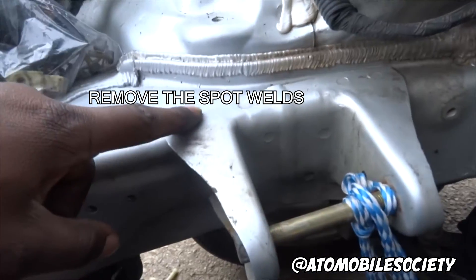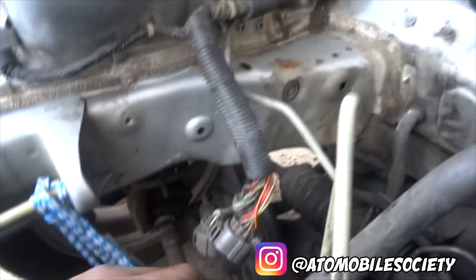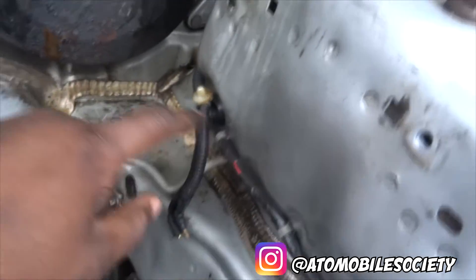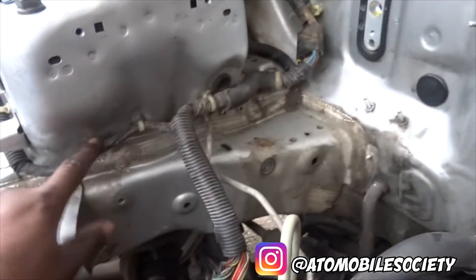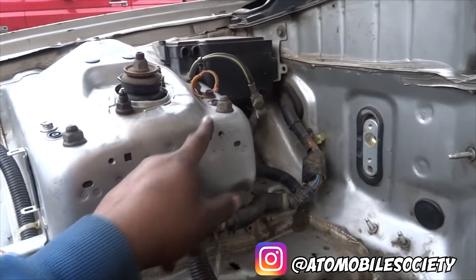I decided to remove the EVAP canister — hopefully I don't get any cabin smell. This is the line that routes to it, so I may cut it low and vent it down to the bottom. We still have to remove the rear mount and spot weld these out — I already made a video on that, I don't want to bore you guys. For the side harnesses, passenger side and driver side, this is the biggest task: I need to de-loom all this. This line runs all the way to the back — all these sub-harnesses for the OBD2 need to be removed so I can tuck this into the fender. I'm going to leave the battery and fuse box in the cabin area.